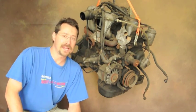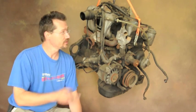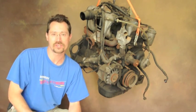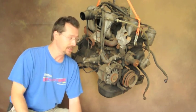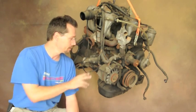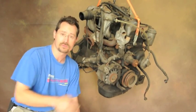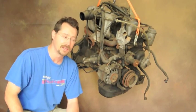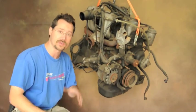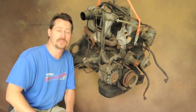Last time I pulled an engine out of a car, it was out of a Geo Metro, and I was using literally a clothesline. So this time I upgraded — I've got a decent little one-ton chain hoist here. I backed my pickup truck in, hooked it up, lifted it, pulled the truck back out, and now I'm at the point where I'm going to lower this down onto a furniture dolly. I'll put some 2x4s in there to support it level, do the same with the transmission, and then I'll have them both on wheels so I can start moving them around, take some measurements, and figure out what I have to do to put the engine and transmission together.